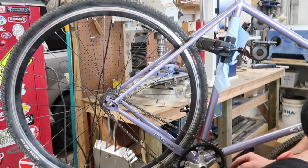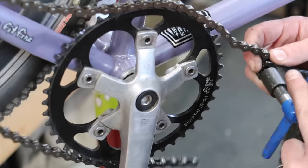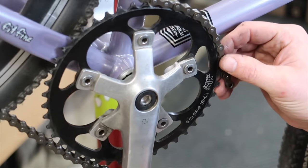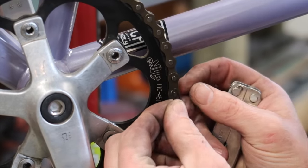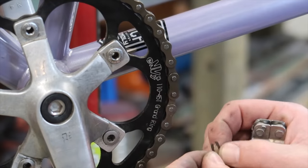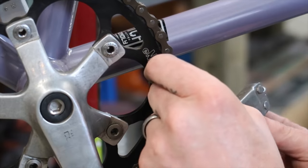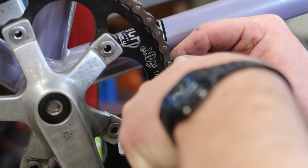Alright, I think that's good. We're gonna pop that chain right there - we'll get rid of this link. I'll get this little connector link. It's actually pretty low quality chain there. You want this little tail part to be away - you want the chain traveling like this so if anything hits it, it's not going to pop it off. You've got your connector link here like that, you put your plate on. There's two little grooves in here that it slides into. Just pop this on like that - done. Chain is connected.